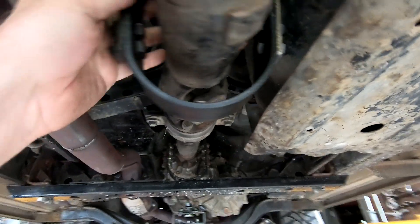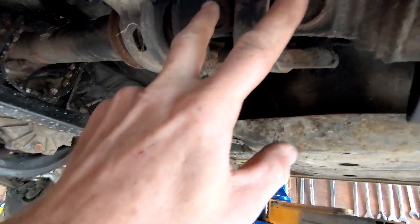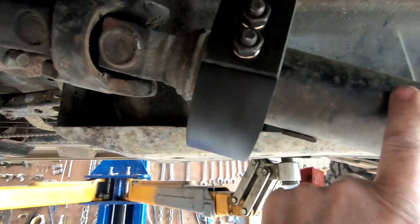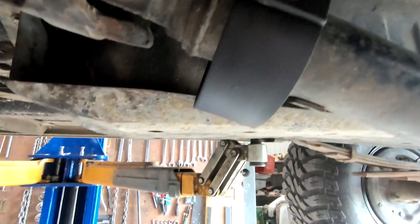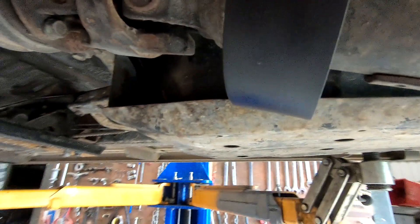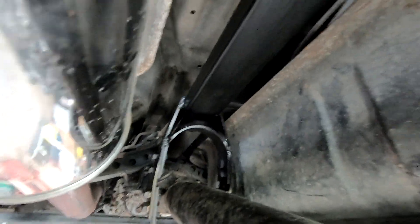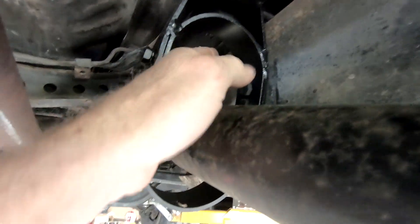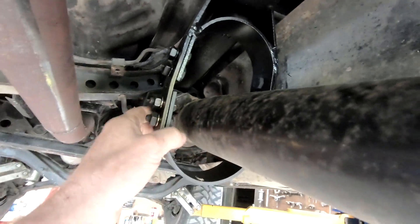Check you've got clearance for the bolts. 150mm from there to there is ideal, but they'll allow you to go out to 250. If you want to check, get the spec book out — I was reading it last night. Bolted in nice and strong; I could hang off that no problem at all. It's going to handle the force, and I've allowed for the movement and articulation of the drive shaft as well, because you really don't want that hitting. Of course the diff moves up and down too.